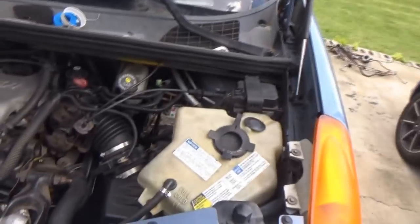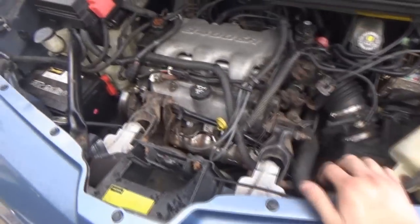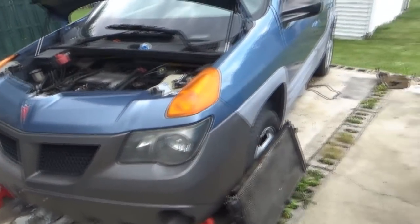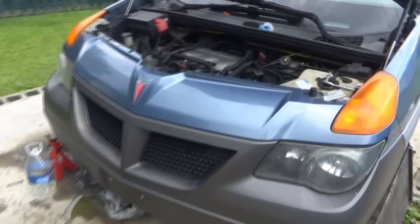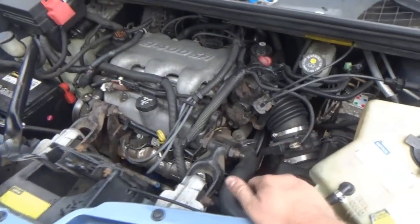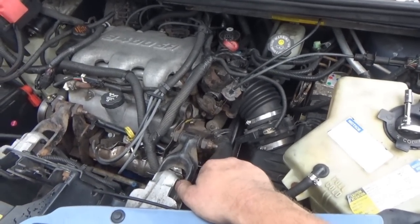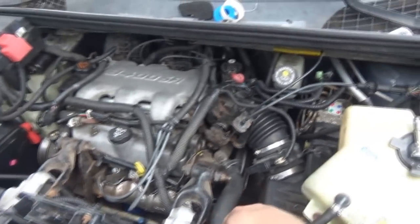I think we're just going to call the vlog now. It's a really long video - hope you guys stuck around. Hope it gave some of you guys an insight as to what you've got to do to change a radiator on an Aztec. At this point in time, all I've got to do is get transmission fluid in it, power steering fluid in it, get some front brakes and some front tires - and technically she is then ready to be driven. Plus a couple of other little things. The mechanical thing should be good at this point. Gotta get some good gas treatment in her because I think I've messed her up with running out of gas.